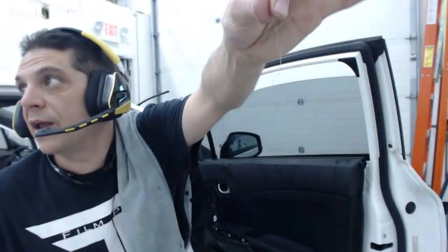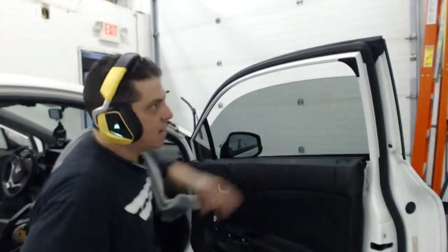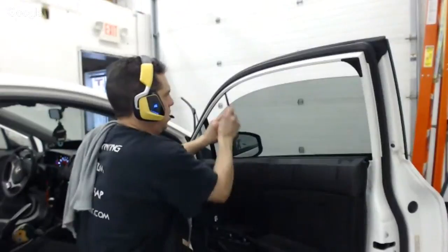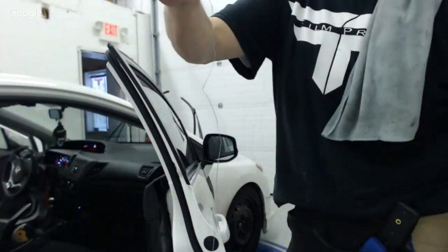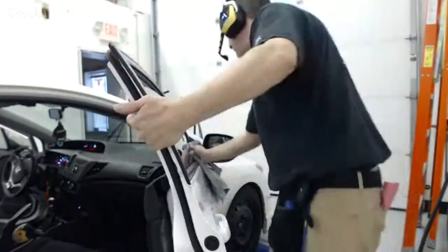All right, and you can see this time it's really fine. It's hard to even see what I got there, but some of it fell on the floor outside. I'm going to check my edge, look for burrs. I'm going to go over with a little bit more side action now. All right. Here's the rest. See that? That's what we've removed. And now we've got a beautiful filed edge. Really professional look. I charge extra for that.